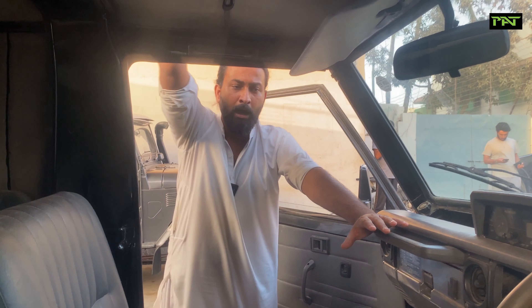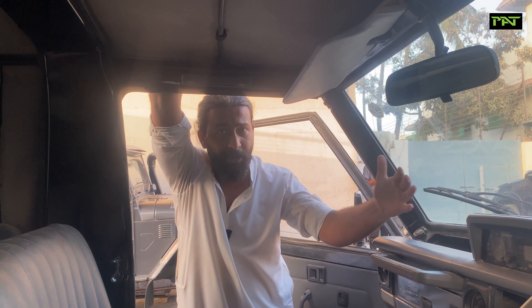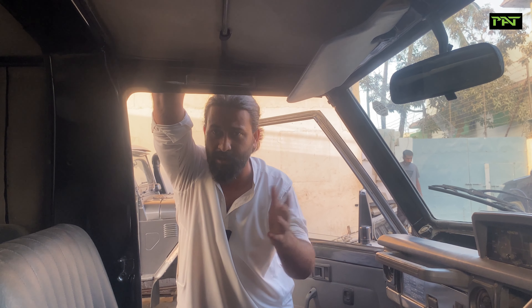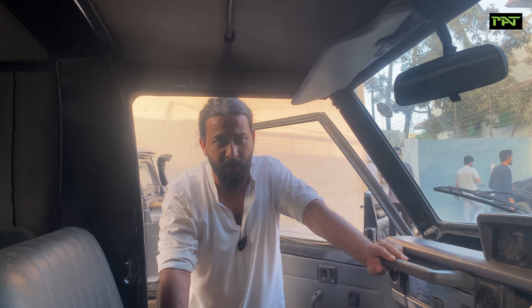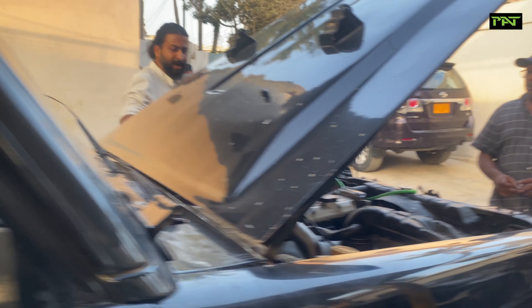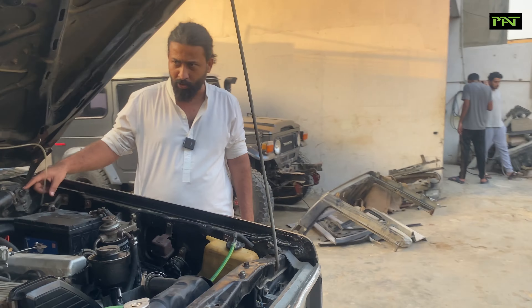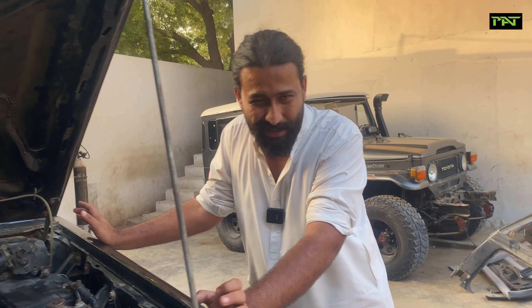Further on, if it's the client's choice, we can go back further. This car originally had a modification job — modification and mechanical reset. When we had the dash off it, it was completely stripped. It took us a lot of time because we had to redo all the wiring, even the headlight assembly, wipers, etc. Everything had to be powered up. Now we are going to check the wipers — just a connection. We have to check the wipers, yes — the wipers are working but just need finishing.